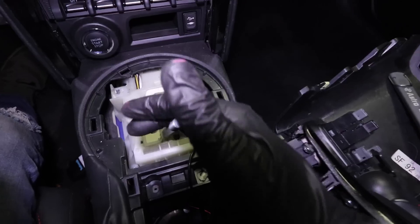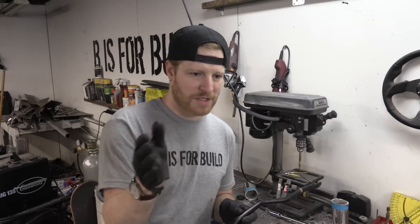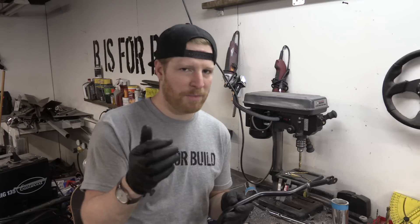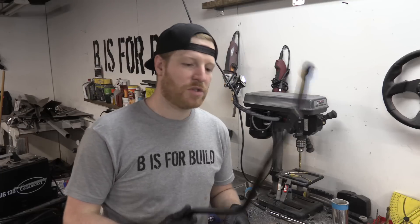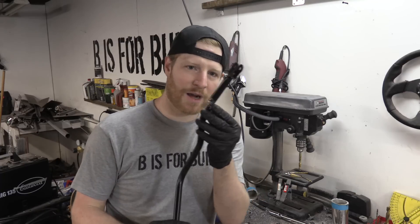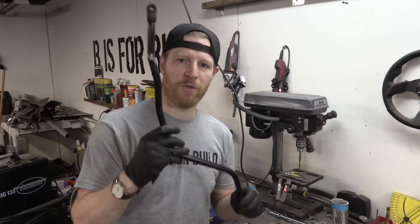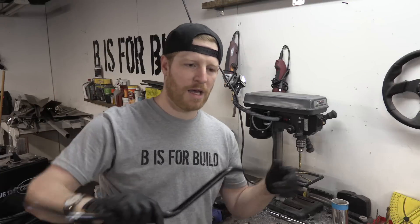I modified the rest of the shifting mechanism inside the cabin to get into that lowest gear. With the Aristo it's drive, and then drive-slash-third — you bump it over to go third, which I don't have the computerized stuff for — then one more down is second, and then the last one is the lowest. I won't be using that one anyway, but it's good to have. The shifter linkage is tack-welded right now, so I'm going to grind it off, weld it all the way up, paint it, and do the full reinstallation.